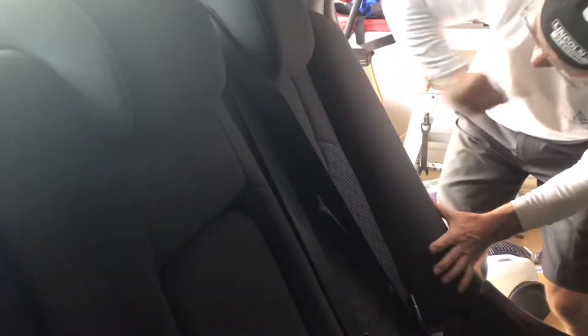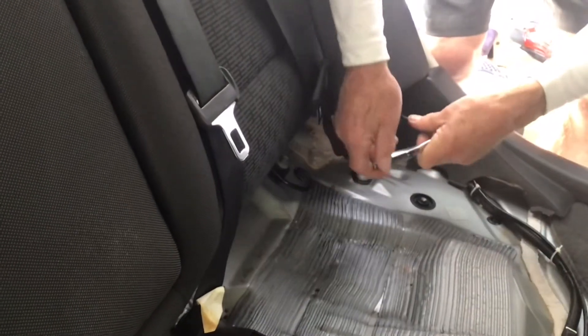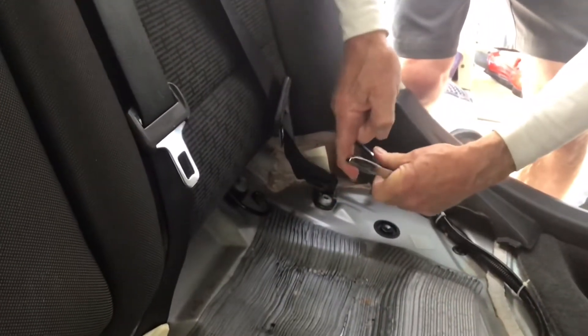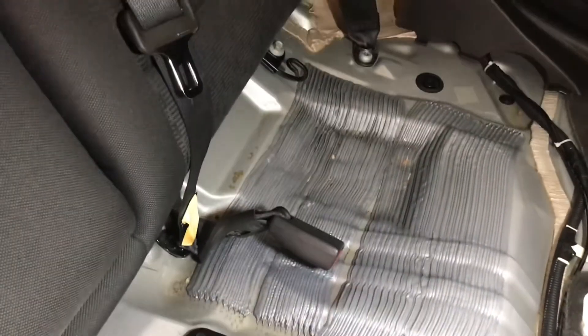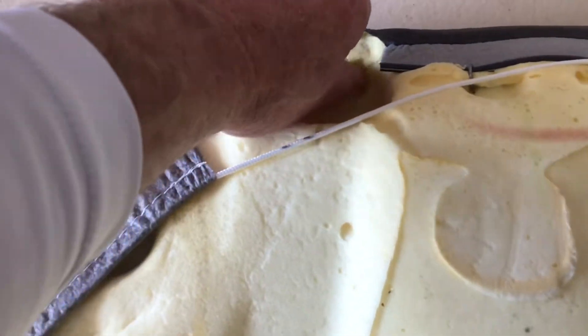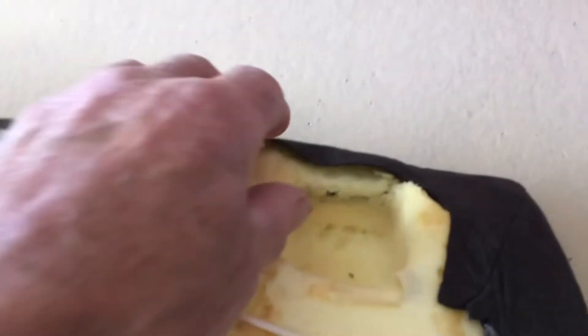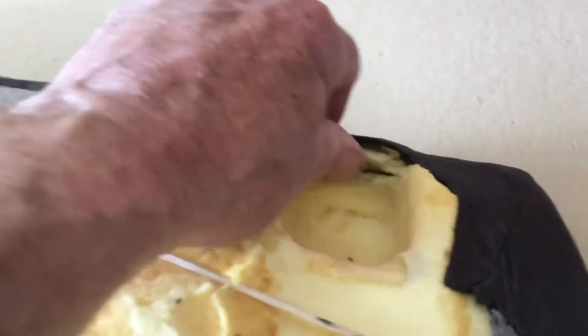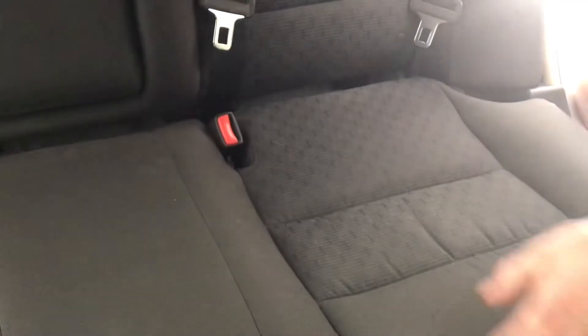After you have buttoned it all up you can attach the seat bolster. Line up the tabs and tap it into place — you know you're in the right spot when the bolt hole at the bottom lines up. Reinstall the 10 millimeter bolt, but it's a plastic piece so don't overdo it. You can see the u-shaped brackets at the back of the seat area where it will attach to the metal rods underneath the foam on the seat cushion. The black steel rod is just underneath the foam. To install it, it's one of those feel things — you can't see the bracket engaging into the rod, but you know you've got it when you can't pull the seat cushion forward.